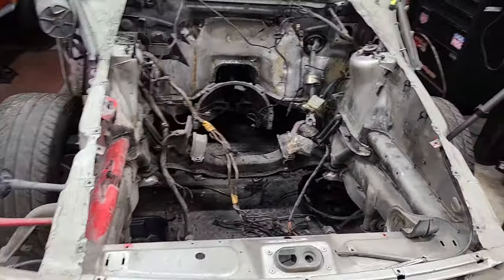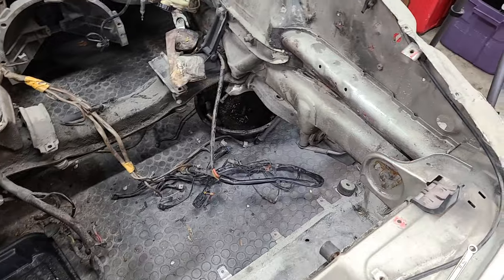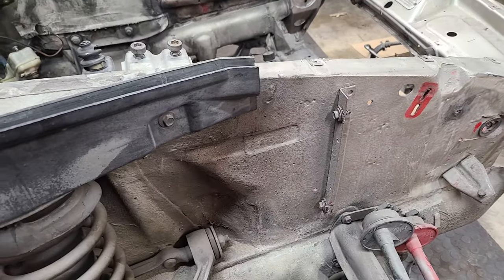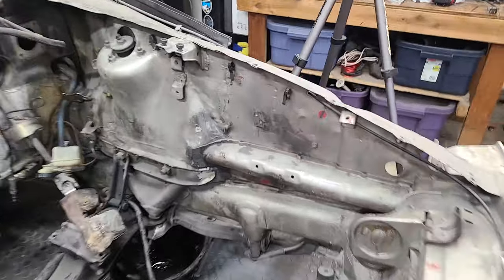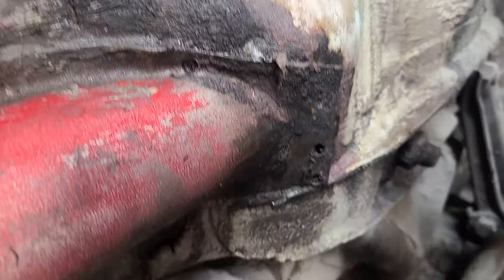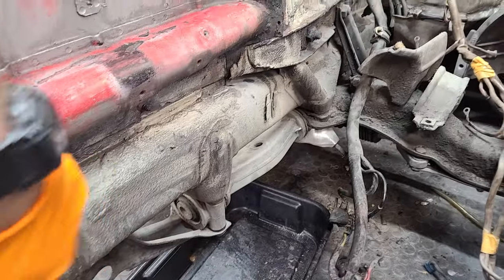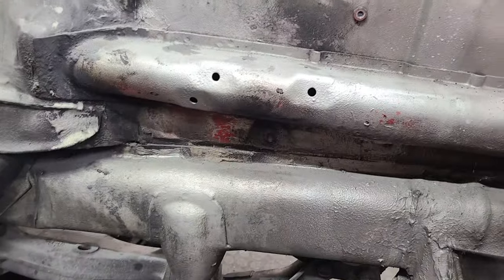After a few minutes with some lacquer, I was trying to figure out why things in the front of the car were red. After a closer inspection, it looks like this car was in an accident of some kind along the way. You can see here there's a seam that goes right up through here on both sides — you can see where they cut the firewall. It actually looks like they did a fairly decent repair, and it went through this bumper support. Looks like they didn't do a very good job of tacking that back onto the fender well there. But otherwise it looks like a fairly good repair — it doesn't look like it got into the structure. It was all upper, up above that.